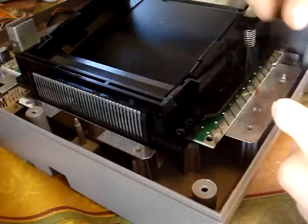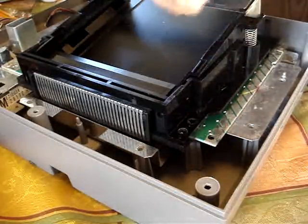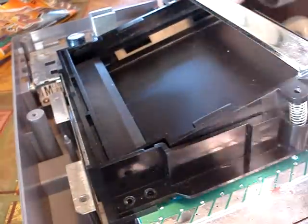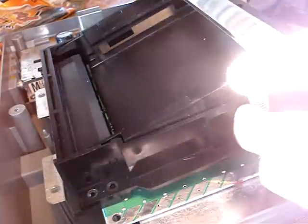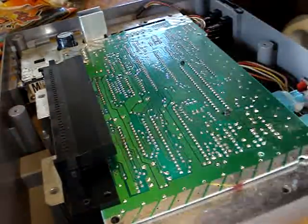I had to get a little pair of pliers and get that screw out. The hole is stripped — we're going to have to use some plastic repair stuff to fix that. After you take all the screws out, this black thing slides forward. It should slide forward — you'll need both hands to do this. Watch out for this thing here, and it'll just gently pull right off, just like that. That's a separate thing — it comes right out.